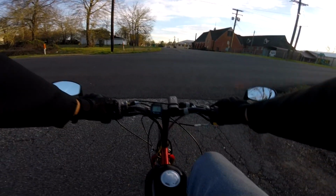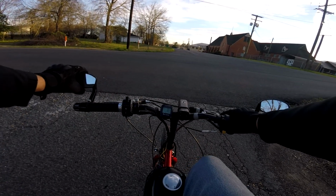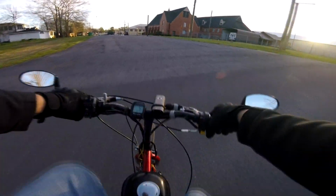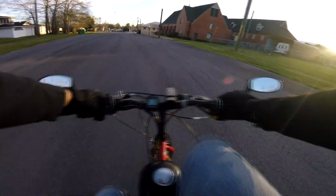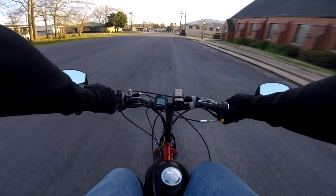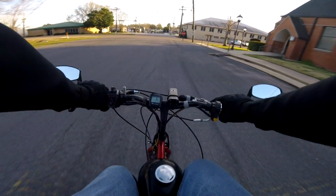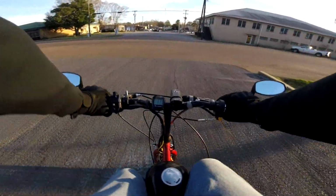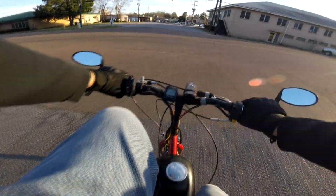So first off, the motor will only run if the battery pack is plugged in. And this is strange for a number of reasons. First, it doesn't matter if the battery is turned on or turned off, only that it's plugged in. Second, the generator only has one wire, the positive connection. And that positive connection connects directly to the battery pack.